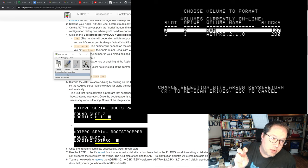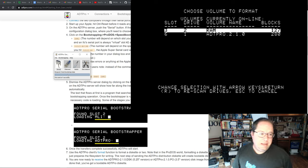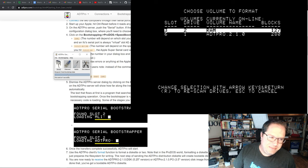It lists the drives it sees — there's a RAM volume in slot three and a disc in slot six. If you know about Apple IIs, slot six is where you put the disc controller, which connects to the floppy drives. What's interesting is the Apple IIc has no physical slot six — it's hardwired on the motherboard, no actual slot to put anything in. But the software still sees slot six. On a regular Apple II you'd have a physical slot six, but on the IIc that slot has been removed while the connections remain.